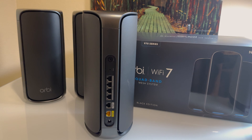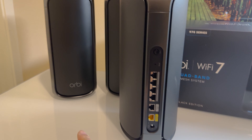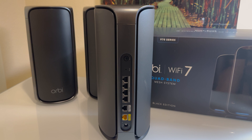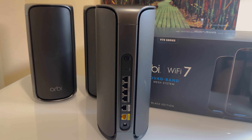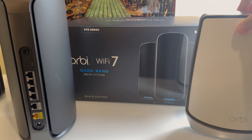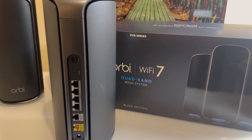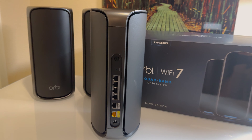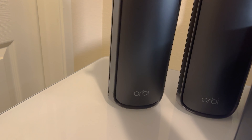So to summarize: Wi-Fi 7's benefit is not just for devices that will eventually support Wi-Fi 7. Anything attached to your satellites should now talk to your router at Wi-Fi 7 speeds. For once, we will probably be able to achieve a wireless mesh network akin to wired speeds, which really has not been achievable in prior Wi-Fi generations — including Wi-Fi 6, where throughput was around 500 megabits. Wi-Fi 7 promises the potential of finally reaching gigabit ethernet speeds.